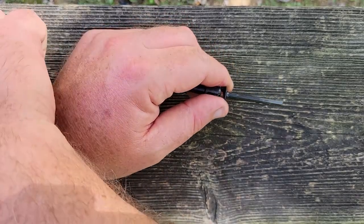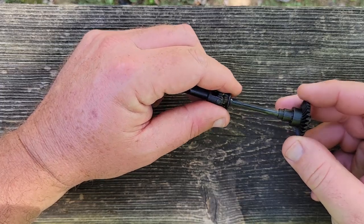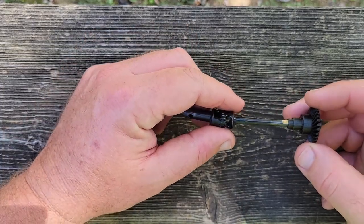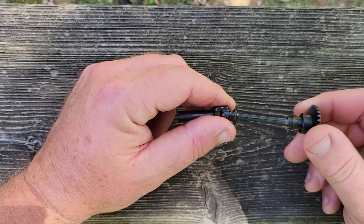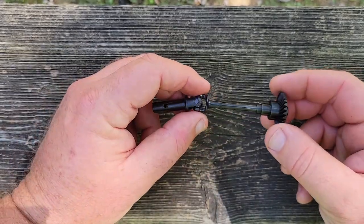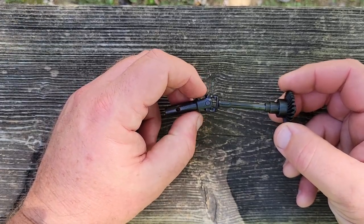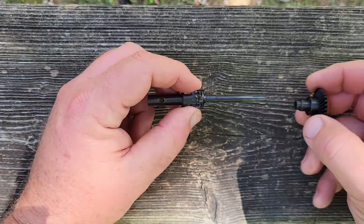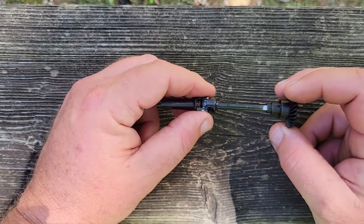Now see, it's looking pretty good. Looks good. See if it fits — look at that! Guys, there you go. It's got a little bit of play in it, but it'll be fine. That's how you cut these shafts down. So if you've got an axle that you like — I really love the design of this axle, the housing and all that stuff — but can't find good strong axle shafts for it, that's how you chop down shafts and make them fit. Easy peasy, guys.